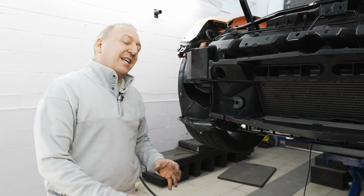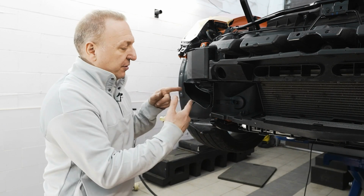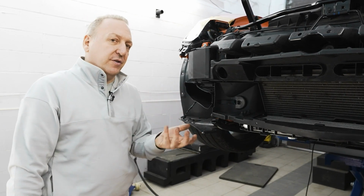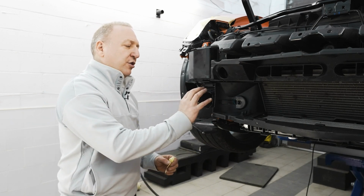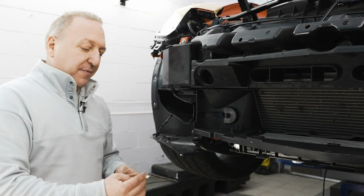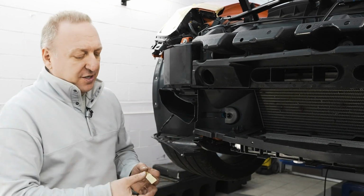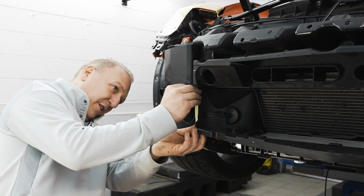The ACS grill does have LED lights and also a very different brake cooling funnel that goes into the Z51 cooling ducts. So what we need to do is make extra provision. There's two modifications that are entailed. One is the radiator shroud, two is the ductwork itself. So I'm using a 3/4 inch tape. If you don't have tape, obviously you can measure. This is my reference, the outer edge, 3/4 inch tape on the flange all the way up.